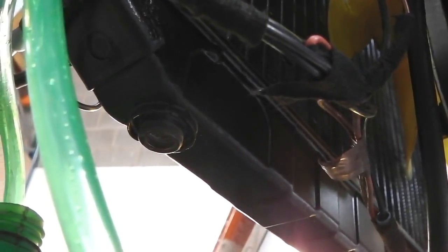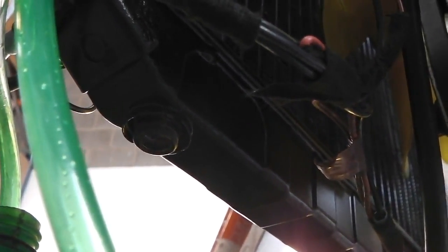These connections are where we make the hookups for the cooling. Inside the bottom section of the radiator is a cylinder, completely independent of the rad itself. Now, if the cylinder failed, water would be introduced to it, but it is a thick-walled cylinder. If you're on top of your maintenance, there's no reason why that should fail at all. People do fit their own coolers on them, that's fine. And the only disadvantage with that is that you don't get the preheat effect, so your gearbox doesn't get up to its correct operating temperatures in winter time and in cold climates.